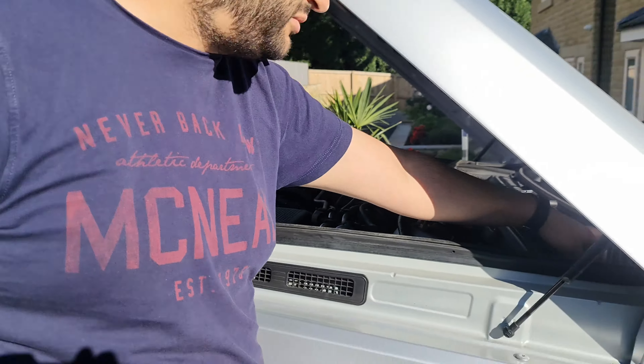That cover just covers the red connection. You have black and red — in theory that's plus and minus, just like any battery. So that is the plus and that's the minus. This is a 10mm — we've been using 10mm. For the plus, which is red, you need a 13mm, so I'm going to disconnect the red one.